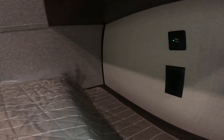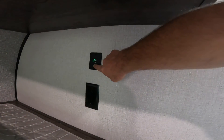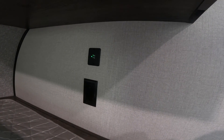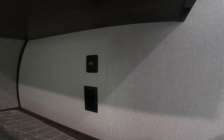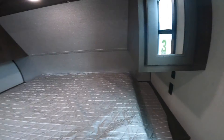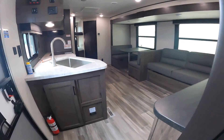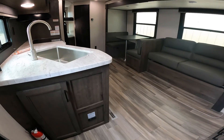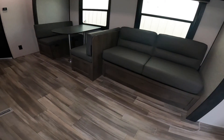On this side of the bedroom, note some USB charging ports. One thing to be aware of: if you leave your battery connected while not using the RV for an extended period, these charging ports will put a small draw on the battery. Nothing to be immediately concerned about, but over a longer period of time they will deplete the battery.